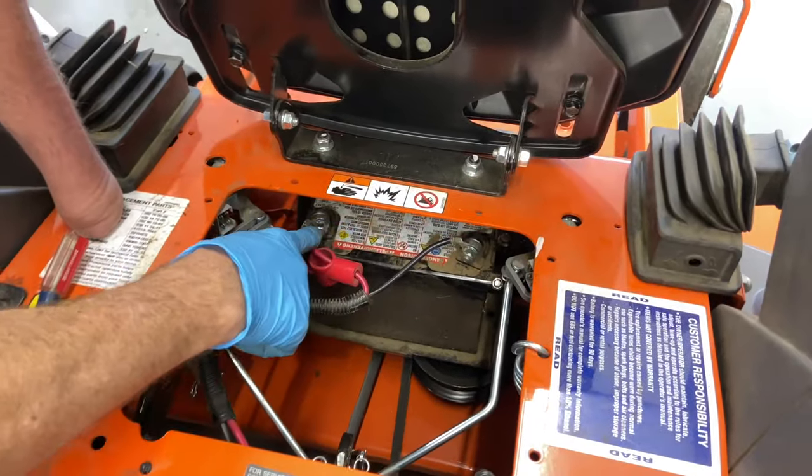You can charge the battery up if you have a battery charger to get you by. But if it does not start week to week, it's not good for the charging system — when you charge up the battery and it only lasts a week, the battery is draining as you use it, which taxes the charging system on the engine. So don't keep jumping it or charging it week to week — buy a new battery.